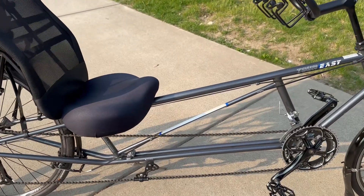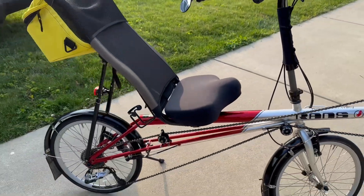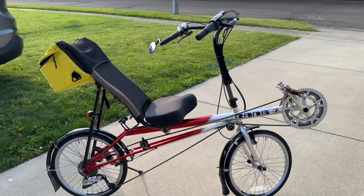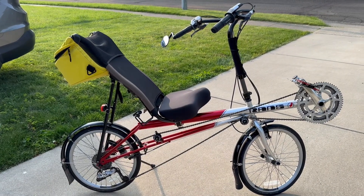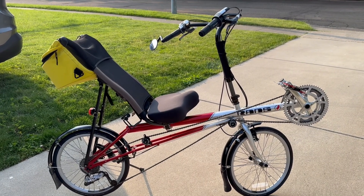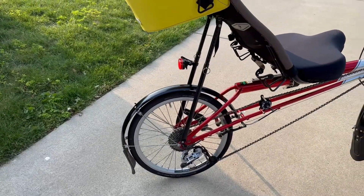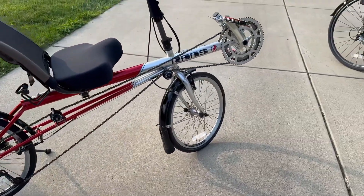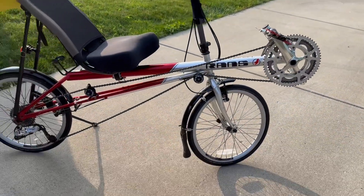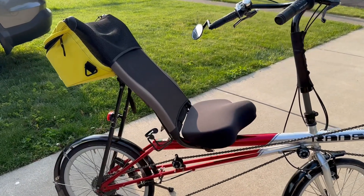There are better candidates. This one is a third-generation RANS Rocket. The frame is steel, so that bike is heavier than you'd think, but definitely rugged enough to take a mid-drive e-assist. The wheels are 406s — 20-inch front and back with lots of spokes — so I don't think you'd have any problem there. But with your feet up high and needing to get them down quickly to handle something unexpected, it's probably not the easiest candidate.